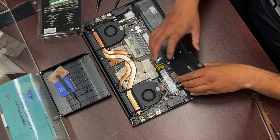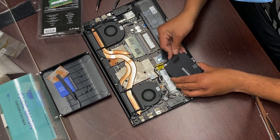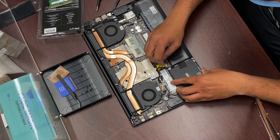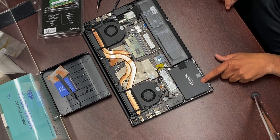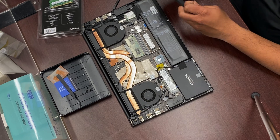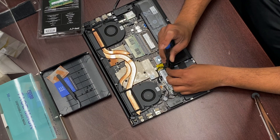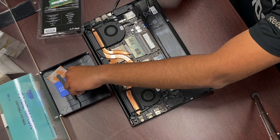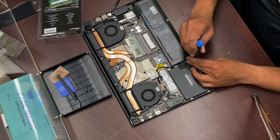After you're done, make sure you connect your SATA back again. You'll see that I'm trying to place the SATA — sometimes since it's a new SSD, it will take a little bit of push, so don't be afraid. Just push it in and then place it at the bottom section of your laptop. Remember the screws we were talking about — do not confuse them, as I've separated them from the beginning. These screws have different dimensions and size, so the black long screw goes on the top and the silver small one goes at the bottom, and the rest two screws go at the back. Just screw that back in and make sure you do not drop the screws onto the board.